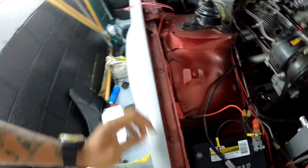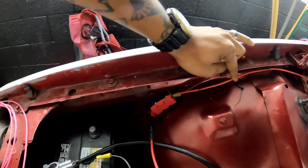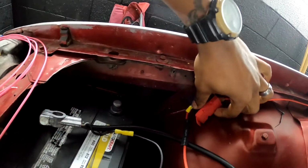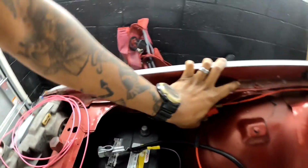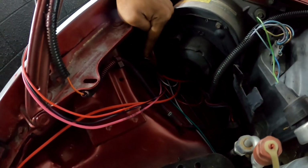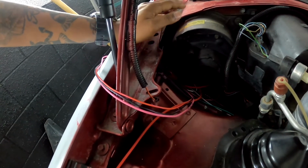So this wire right here is the wire, that red wire that comes off the back of the switch panel, okay? And Painless sends you this nice little circuit breaker that comes with a fuse, right? That mounts right on top of that, which is super awesome, makes it super easy to do. Now, number 30, just like off the switch panel, number 30 on the wiring for the relay clusters into this big wire right here. And I have that wire ran to a source that gets 12 volts with ignition, okay?